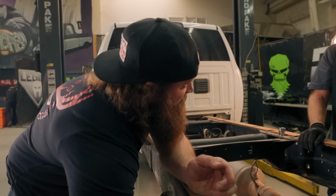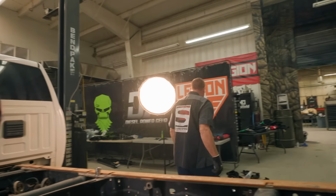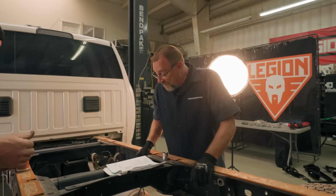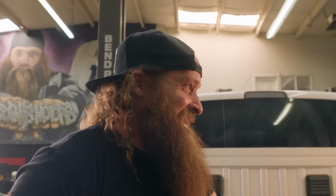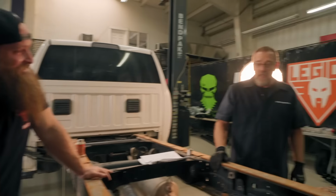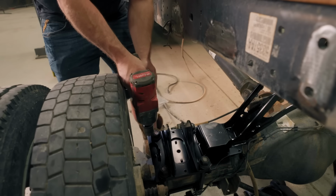So what's our wet torque on these? It's a 5 step torque. The first one's 100 foot pounds, 200, then 300. Okay. You want to handle the 300 and I'll get the rest, Doug? No. We can use a gun, just go slow so we don't get them hot. We'll just bring them down snug. And then we'll start bringing the torques up from there.